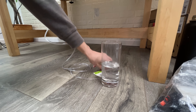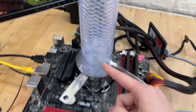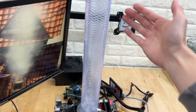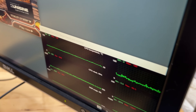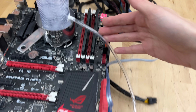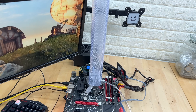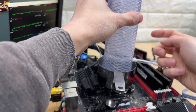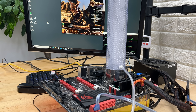At this point, it's been around three hours or so — I started the test around 4pm and now it's just past seven, and the ice is all but melted. The crazy thing is, if we scroll back over those three hours, the CPU temperature never ramped up at all. The ice was able to keep a very steady temperature basically up until now. If we didn't have the water draining out with the extra tube, the water would naturally heat up and the temperature would increase over time. But because we're draining that out and allowing ice to keep pushing down, it's just constantly keeping it cool.